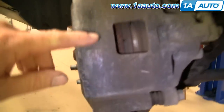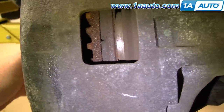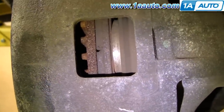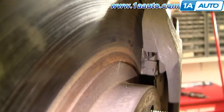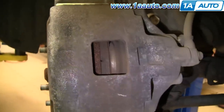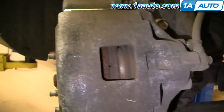Now with your wheel turned, you can see right inside here — you can see that little hole in the brake pad; that is actually a wear indicator. It would indicate that on this brake pad you're in good shape. And then if you look at your outer pad, we can see that there's still some pretty good life left in it. You want to make sure you check both sides, because sometimes one side is not worn and the other side can be more worn. Our brakes are fine — I have checked both sides — but I am going to take them apart and put them back together just to show you how to do it.